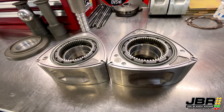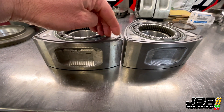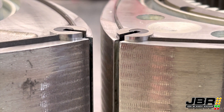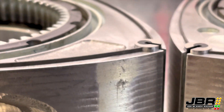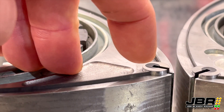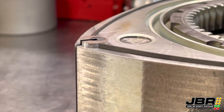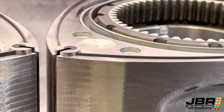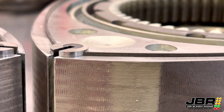With both rotors sitting on the bench facing up and all the side seals in place, we zoom in and have a look around where the corner seal and the side seal bite up against each other. It's pretty easy to notice which one's got the dodgy spring behind it and which one's got the good spring. Generally when the rotors are assembled, the height of the corner seal and the height of the side seal are roughly about the same, uniform all the way along the length of the seal. If we move over to this rotor it's really easy to see how much lower this side seal sits in the groove compared to the corner seal.